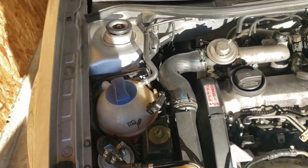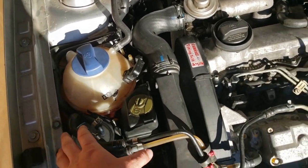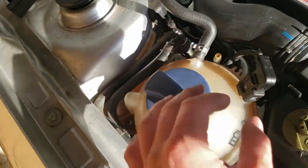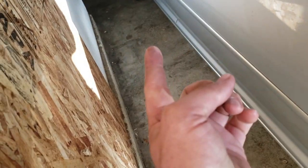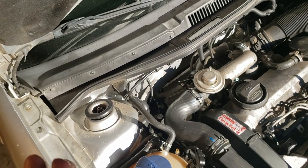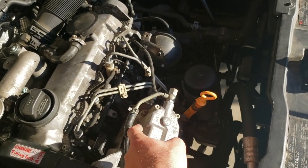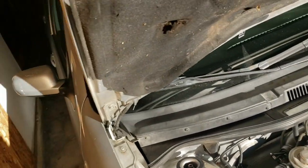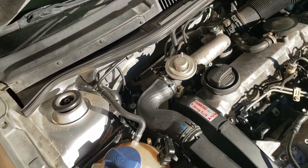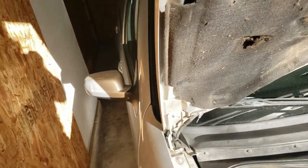The reason this happens is not anywhere in here — it's because these connectors here, and another pair of connectors under the car that go to your fuel tank, have little O-rings. Those O-rings are only meant to sustain a certain amount of vacuum. When the injection pump starts pulling — and it can pull a lot — if you have a restriction in the back, air will start seeping in through those O-rings. So the air isn't coming from the filter or fittings; the problem is the restriction in the back.